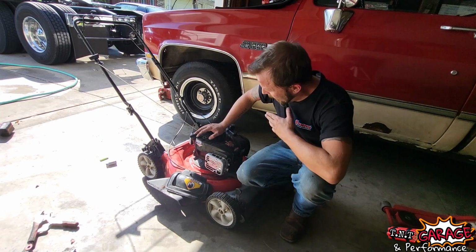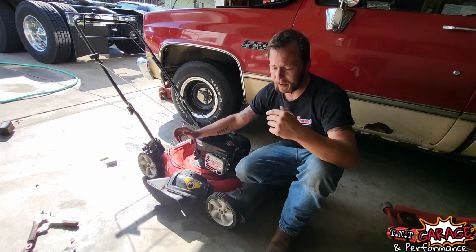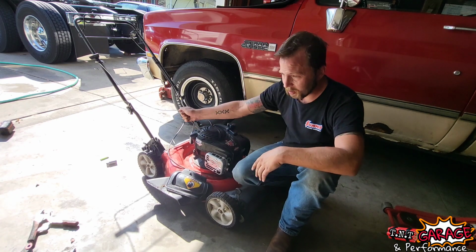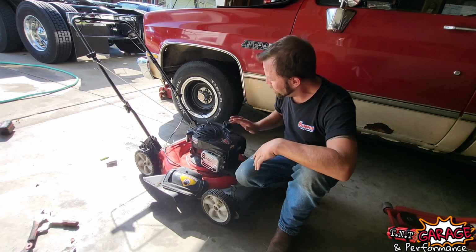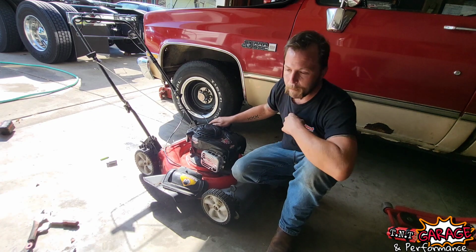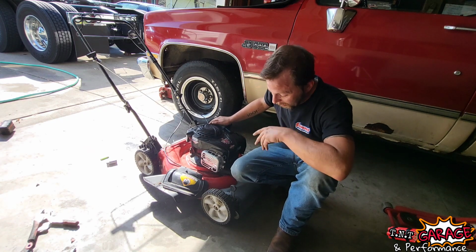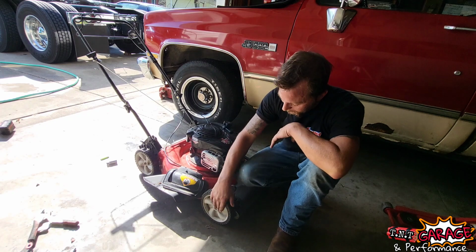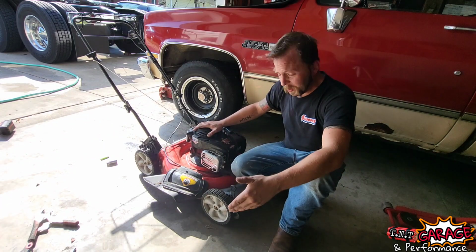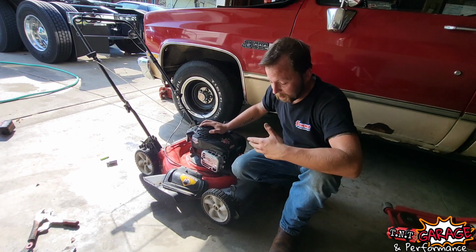Well, so there we go, guys. Got a good running mower right now. Pretty much, I think all it really needed was some fresh gas. But you guys probably learned a couple things along the way. What to check for to begin with. You know, make sure it rolls over. Check for spark. Check your fuel. I took the carburetor apart and got all that crap out of there, blew out the jets, and a little bit of fresh gas, she pops right off. Mowing's great, actually, so I really hope that the person that gets this can really use it, and with their permission, whoever gets it, I will include the act of giving them the mower and demonstrating for them in the video.